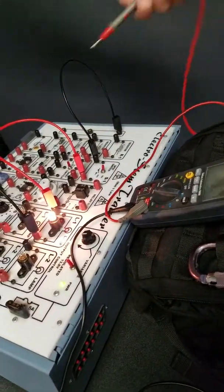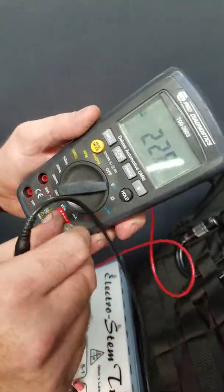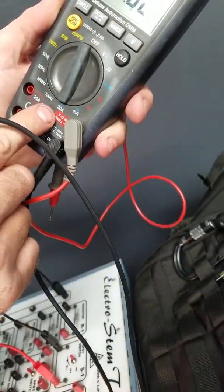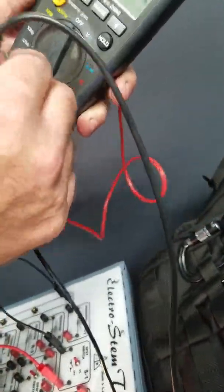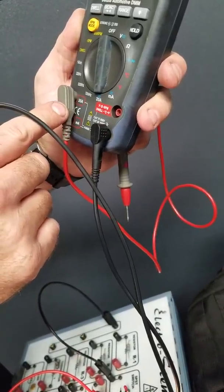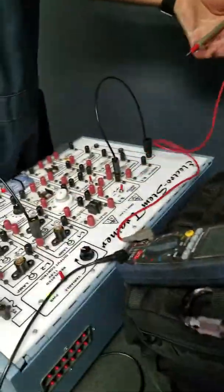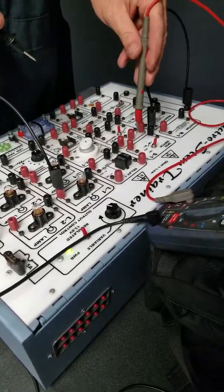All right, now we want to check our amperage. Amperage is pretty simple. What you're gonna do, take the red, take the green, go down to, always start small, go your way up. 20 amps. So we're gonna go large and work our way down. Red's on the 20 amps. The switch is on 20 amps. We're going to take out one of these cables and we're going to test. Now, our light should come on.